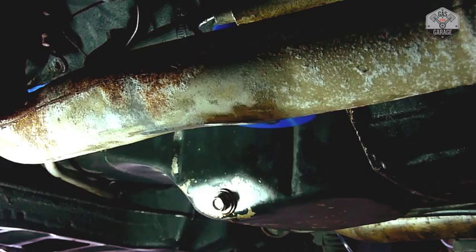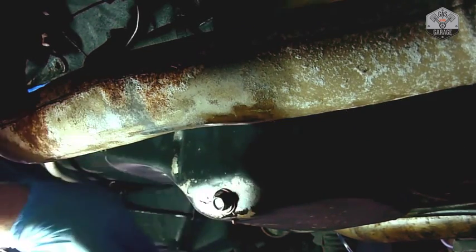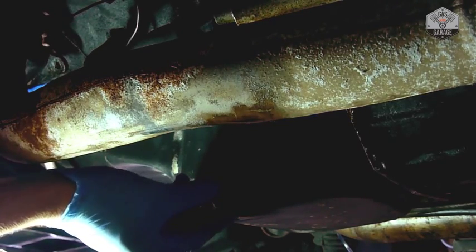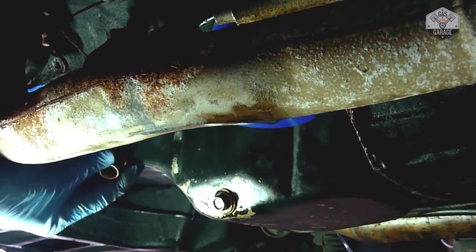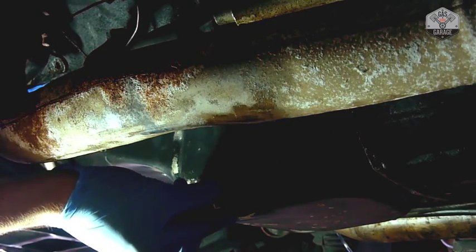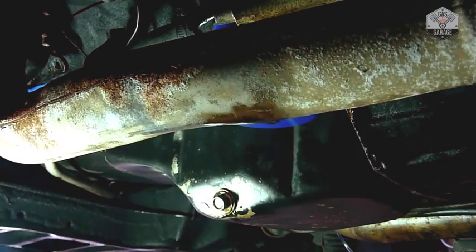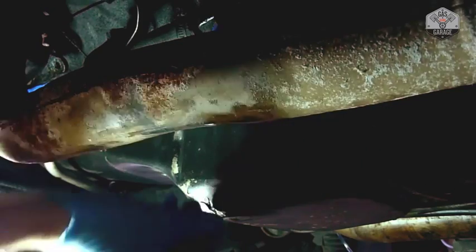So first things first, you want to loosen up this oil pan bolt in here. Okay, and this is going to be a hex bolt, size 15 millimeters. You know, in this car you've got a combination of some hex and some metric and some standard sizes, and this will be a 15 millimeter. What you want to do is, I already did this, I kind of loosened it up with a simple 3/8 inch socket, so that's easy enough.